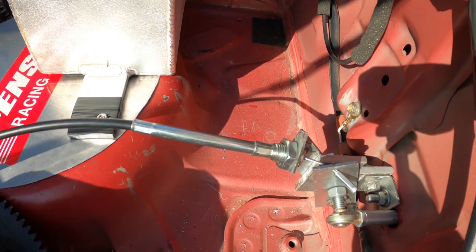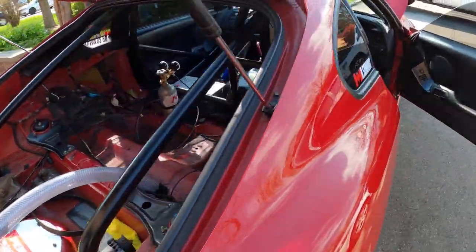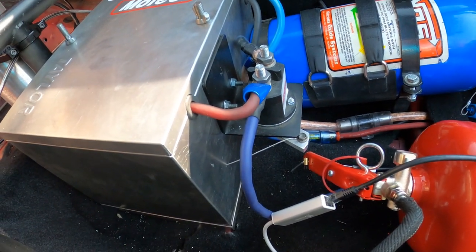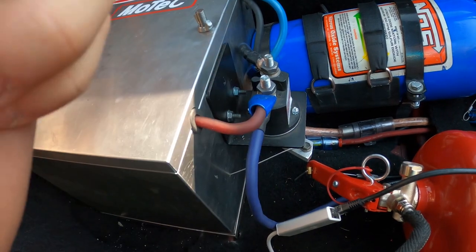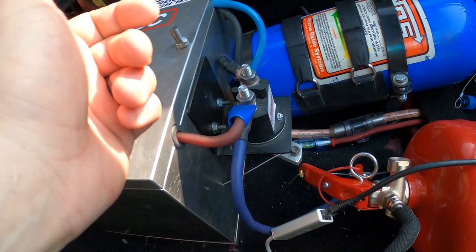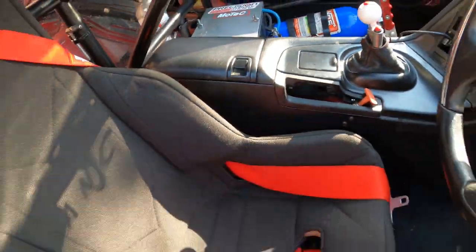You push the turn-off — pushing here pulls this cable, and there's a cable over there that pulls the shutoff. Kind of saves weight too. I didn't want the cutoff in the back because then you'd have to run a thick gauge wire from the battery all the way back there. I wanted the cutoff to stay with the battery, so a little cable works well.